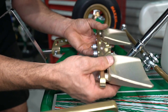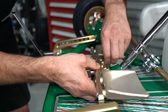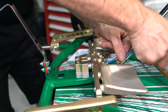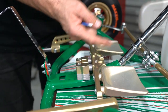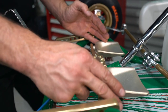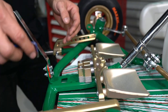So now we can install the two heel rests onto the kart. We're going for maximum adjustment here — all the way back with the heel rest closest to the driver. There's also more adjustment where you can move the heel rest further out, and we can start moving this mounting bracket further forwards as the driver grows.